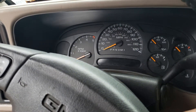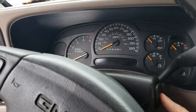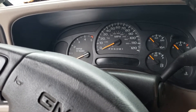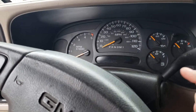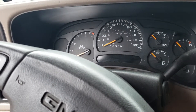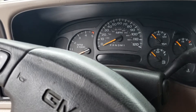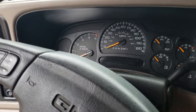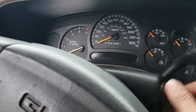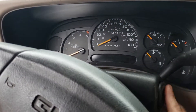I'm thinking diesels don't have that as much, because my security light was flashing but I was able to start it up multiple times with no problems. Just remember to do the 30-minute relearn procedure: 10 minutes on, wait for the light to go off, then shut it off - do that for a total of three times. On that third time, shut it off and start it back up. You just leave it in the run position for 10 minutes without starting the engine.